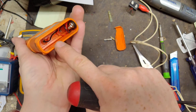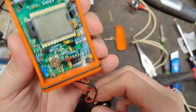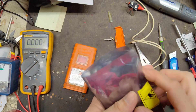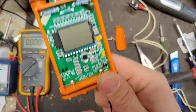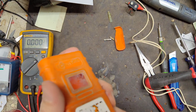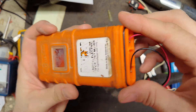Eight point five volts - not terrible. Now we're going to get the circuit board out of there. I've got some corrosion going on - I don't know if that's going to solve or not. I'll go back to this in another video, but let's install a new board and just get it done. This thing is probably 30-plus years old, but here's a brand-new board from 2014, brand new in the package, because they don't make this model anymore. These are about a 50 to 60 dollar part or tester to replace.